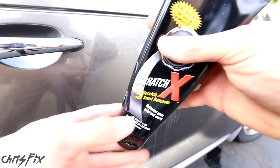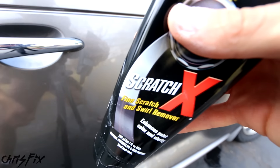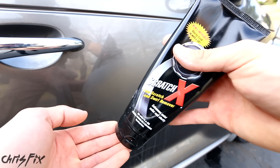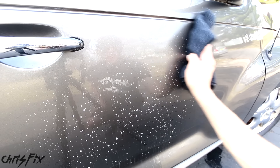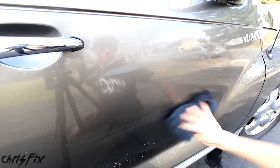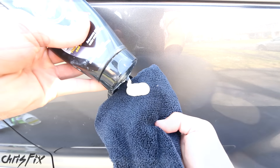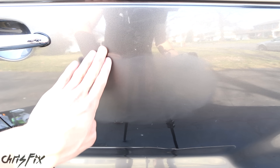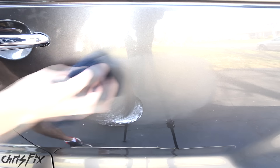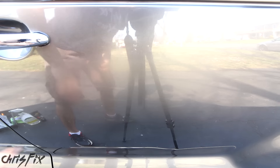Alright, we're on step four — we're almost done. In this step we want to use a really fine polish. If the polish says it removes fine scratches and swirl marks, you can use it. Polish has grit in it, so think of this as between 5,000 to 10,000 grit. Before we polish, clean the surface to remove all the dirt. Now get a clean part of your microfiber towel, put the polish right on the towel, and rub it in a circular motion. We want to focus the polishing in the hazy area but also feather it out into the surrounding paint with medium to heavy pressure.